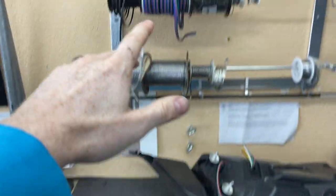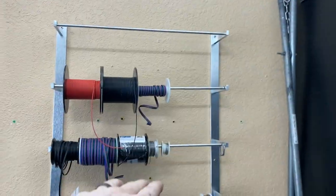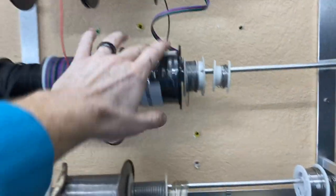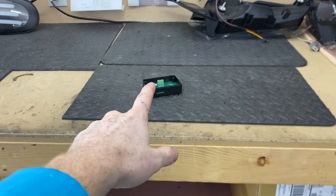I've tried to make wiring these up as efficient as possible. Right up here I have an entire wiring rack — I could use a lot more wire on here, but this is what I use for most wiring. We've got power, and then this goes out to data, ground, and inputs. Right here is the important stuff — that's a loom so you can protect all the wires and it looks a lot more professional. I try to wire up every single harness the same so we don't have to think too hard about it. The rack is over there, and we have this mark on the ground to mark out how long of a power and ground wire we need to get from the trunk to the front of the car. For our data wires I just do an arm's length.